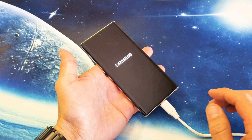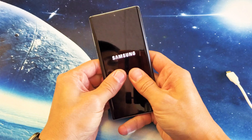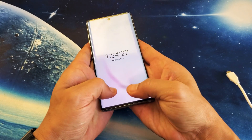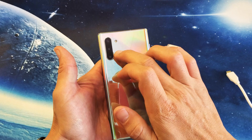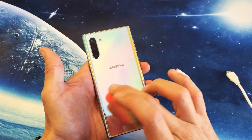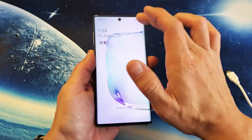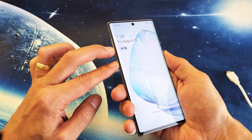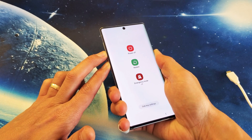Now, if you still have the black screen of death, the next thing I want you to do is go ahead and press with both of your thumbs. Press all over the screen — all over, all over, even on the backside. Press all over. Also, what I want you to do is tap, because a lot of times what happens is it could be a loose connection. Just keep tapping on the front side as well — all on the top, all on the corners. Now do the same thing again: volume down, power button, press and hold both buttons, do not let go. Waiting for that Samsung logo to appear. Here it comes.